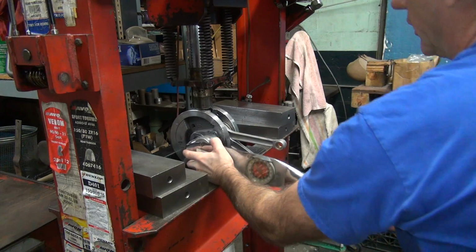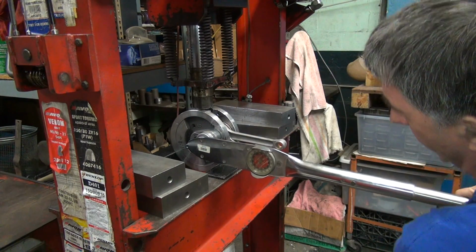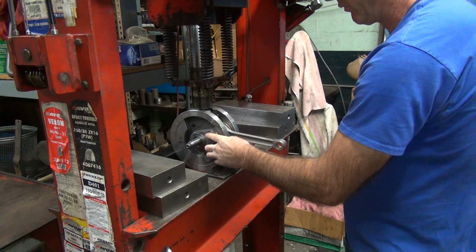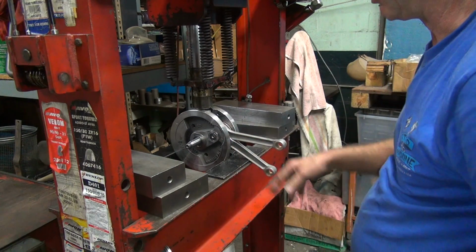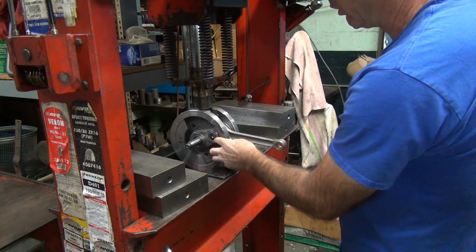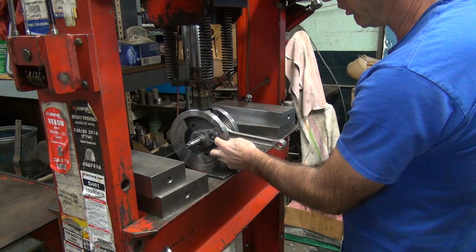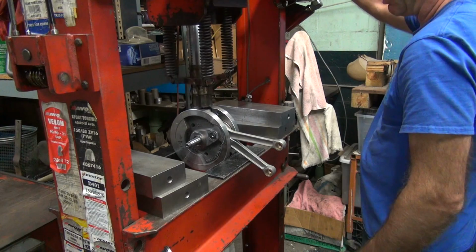There's 250. And there's a little over 320-ish. If you're going to make them tighter, make the left side tighter, because that's where it's going to want to twist. There's more pressure on this side. That's where your crank comes out at power. So the crank pin is just past the outside of the nut, it feels like. So let's pull it in a little bit deeper.